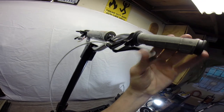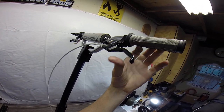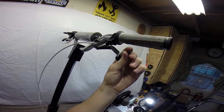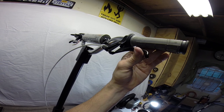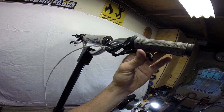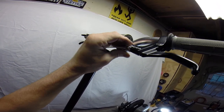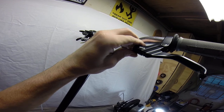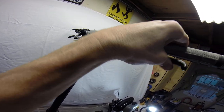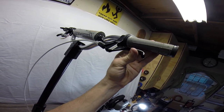Now if you come up here and look at our front brake, you can see how much play is in there — that's about what you want. I've seen a lot of brakes where people pull them and they'll literally go all the way to the grip almost. Me personally, when I hit the brake I want it to grab right away. So that's pretty close. If you want to dial it in a little more, you can adjust the little dial up here — tighten that up a little bit and that makes it even tighter, giving you even less play for a full stop.